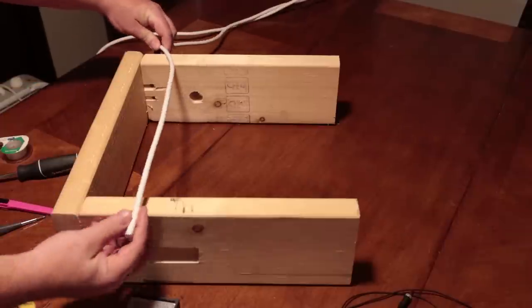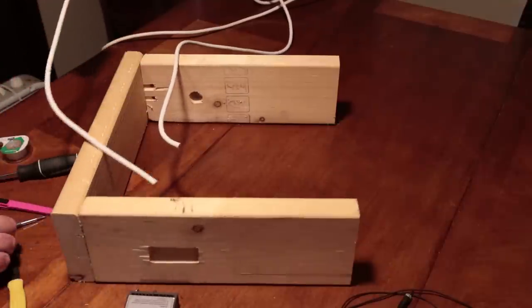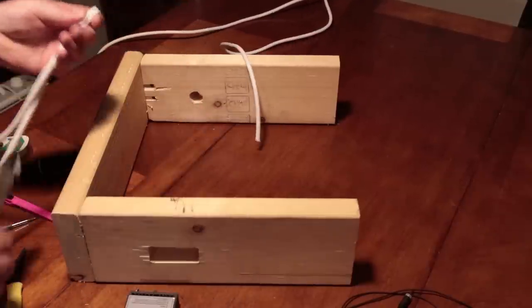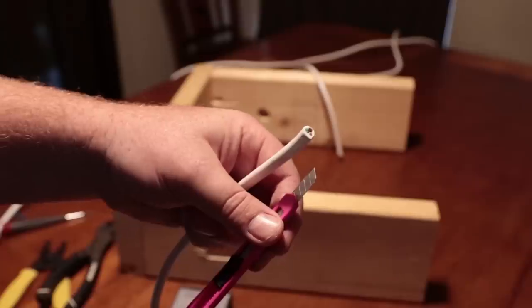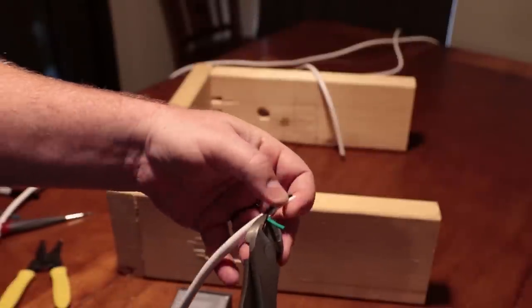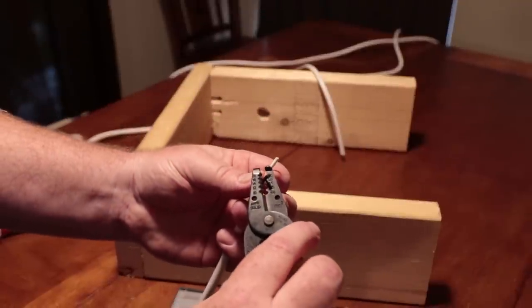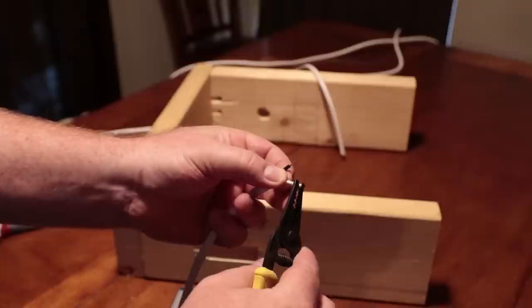One of the first things you're going to do is take your extension cord and cut it close to in half, so you have about 10 feet on each end. Measure out enough wire to run from the ITC back to where you'll put the electrical box on your keezer. We only need two conductors that run to and from the ITC, and I'm going to cut off the ground on both ends of those two wires since there's no ground connection inside the ITC itself.